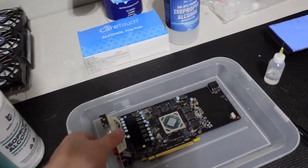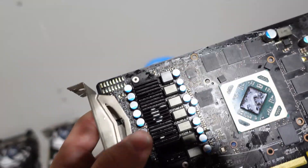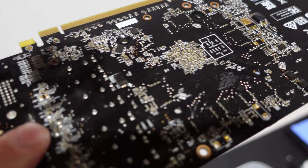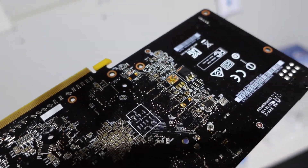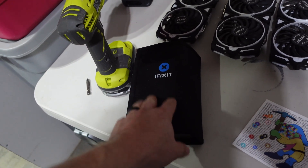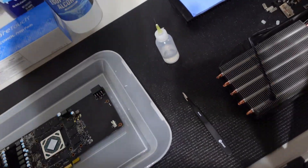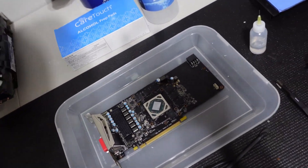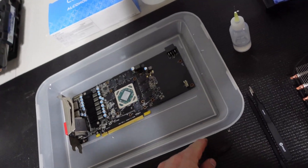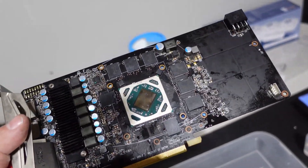Our initial cleaning is done and it's actually turning out pretty good. I'm letting it dry since I really soaked it in the 99% alcohol, but it's looking much, much better than where we were. The thermal gunk was really bad. I went ahead and broke out the iFixit kit — I'll put a link below if you're interested. It has this little pick in it, and you don't press hard, just a little bit, but it works perfectly to get through all the little caps and stuff in there.